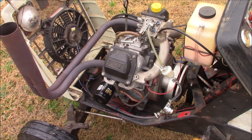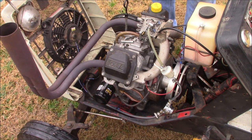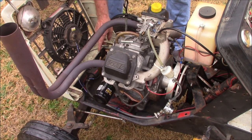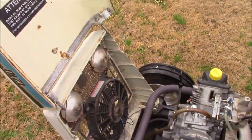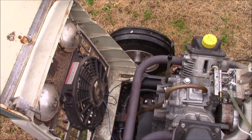On that engine, the silver-looking thing towards the back is the clutch. Lee turned it off while talking. Right in here is a standard single-plate clutch. It's got a regular manifold, regular carburetor, and runs down here with an electric fuel pump. They also have the fuel regulator so they can adjust the amount of fuel going into the carburetor. These things aren't your normal lawnmower — they run 112 Sunoco racing fuel.